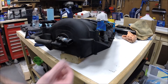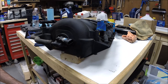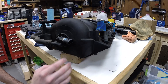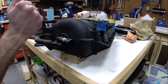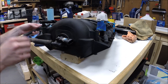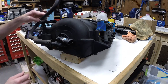This is your MAP sensor - that's just a connector that you pull loose, not too hard to get to. Under here is a rubber vacuum line - it's a little rubber elbow - and the vacuum line dabs down towards the bell housing. You'll have to work with this a little bit; this actually held me up the most. Just twist it side to side a little bit and eventually you'll be able to pull it straight off. Then there's a large vacuum line that would be very difficult to disconnect back here with pliers. The other end runs over to the brake booster, so I disconnected it there, which gives you enough slack. As you pull the manifold out you'll need to snake this vacuum line around carefully since it's routed between quite a number of things.